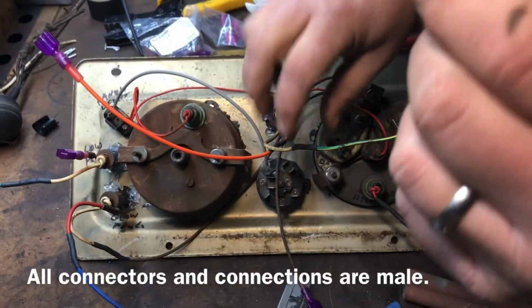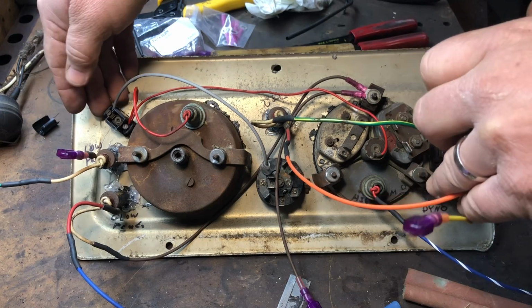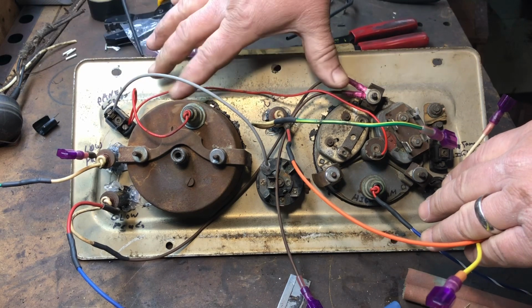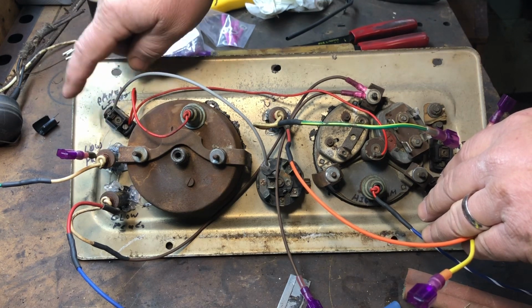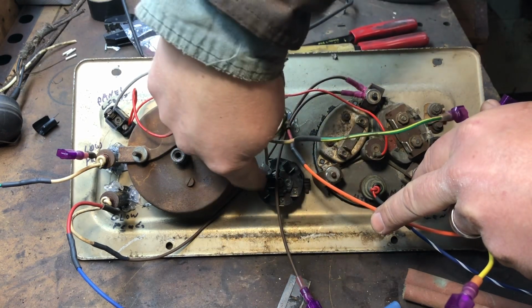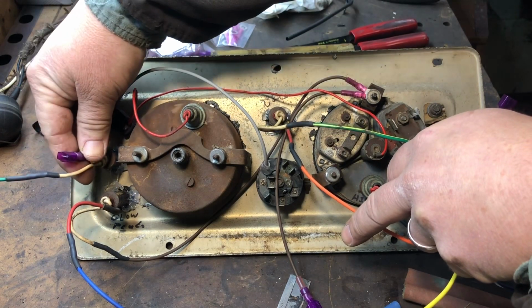All the wire leads are now connected as in the wiring diagram. So I'm going to go over just some of the pieces and parts. We'll start up here in the corner. This is the panel light, and the two red wires here go over to the panel light switch. So when you turn your headlights on, you can turn the panel lights on and off. I don't know why Land Rover did that, but I guess it's an option you could have had. The power coming to it comes from the switch down here. Whenever you turn the headlights, parking lights or marker lights on, this one over here turns on over on this side. So I have that connected to here. And then, okay, so we got that. And then we have our low fuel light over here.